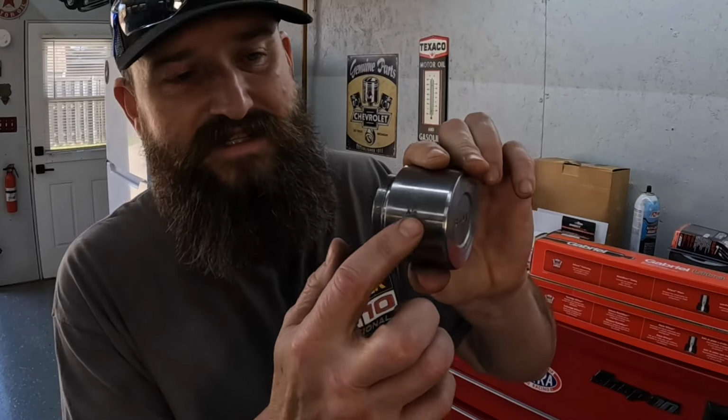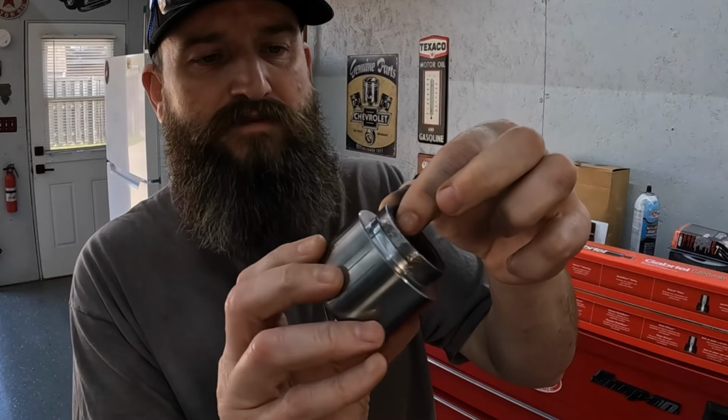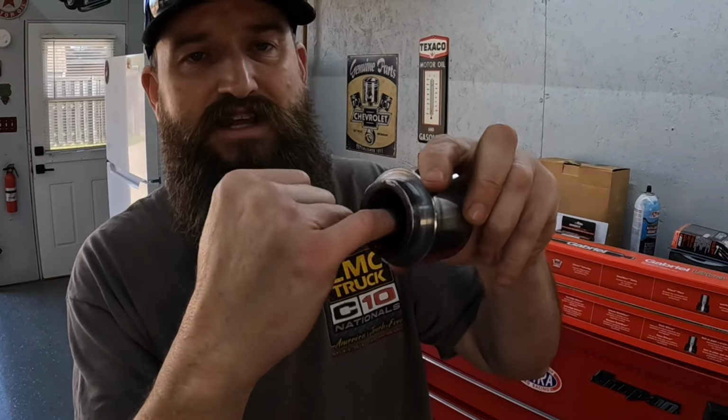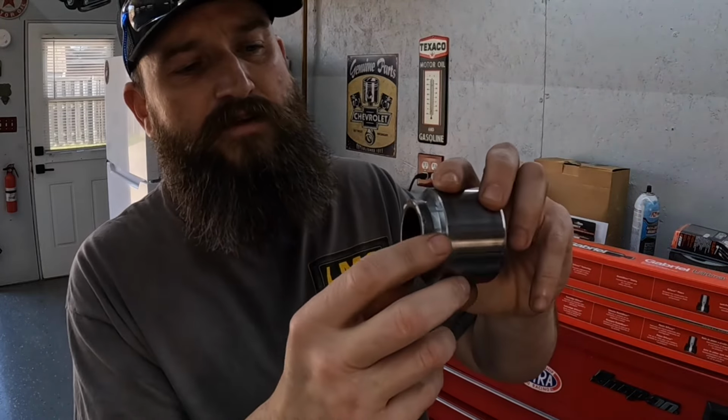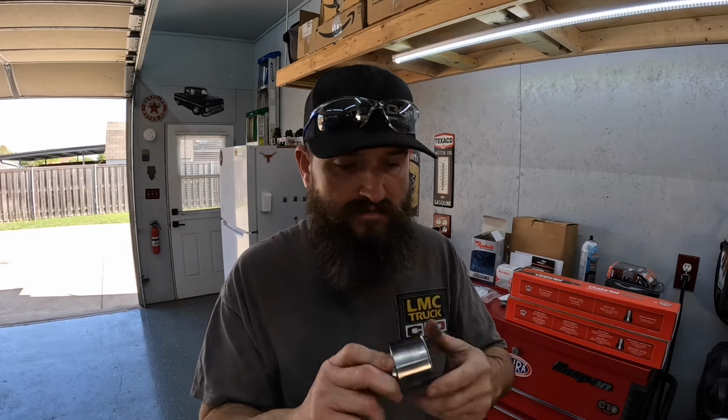To pick back up on the video, we're gonna go ahead and start reassembling that caliper. I got that bore cleaned up as best as I can. It's got a little pitting here and there. So the piston's got a little bit right there. And it's kind of a little bit right there in that lip. Obviously inside here is really bad. Very, very pitted. But that faces out, so that doesn't matter. Backside. Overall, this looks good. And reassembly on that caliper and piston should go pretty good.